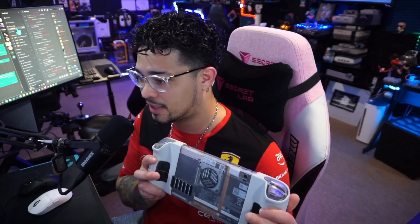Welcome to another episode of 3nv7 Tech. Today we're going over cryo sheets again, but this time using my Steam Deck version one — not the OLED edition, the original first Steam Deck. Currently I have liquid metal installed, so we're going to change it to a cryo sheet and see if we get better performance. The main reason is because liquid metal can spill outside the apply area and conduct around the chip.